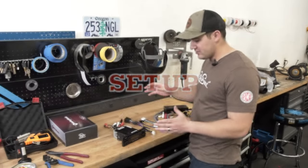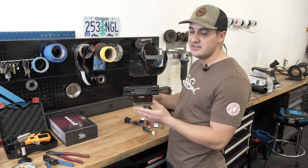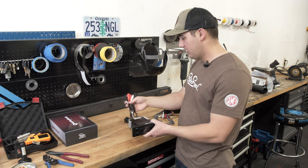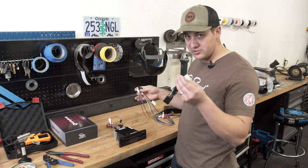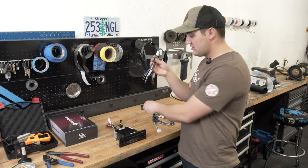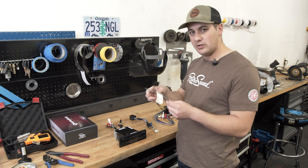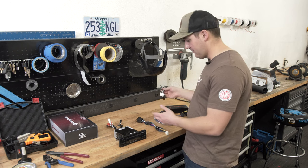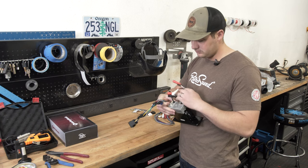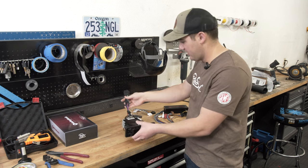Let me show you what I mean by it being an intermediary unit. Today we're working with a Retro Sound Motor 2A — the Bluetooth-capable, middle-of-the-road radio with the Grand Prix face plate, which looks really cool in 80s and 90s vehicles. Off the back of the radio you have the main harness plug with the fuse, the female side of that plug, and your two male plugs that go into your factory harness — covering power, ground, switch power, antenna output, amp turn-on output, and speaker outputs. All of these wires go in between this amplifier, just like normal.